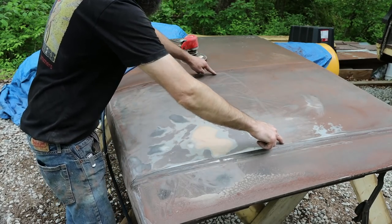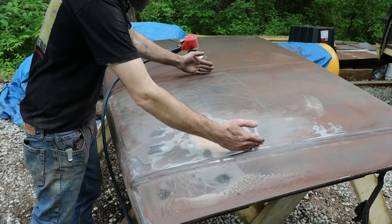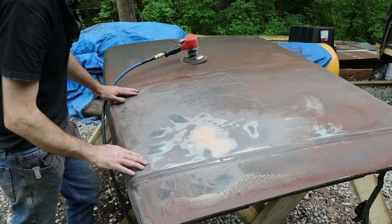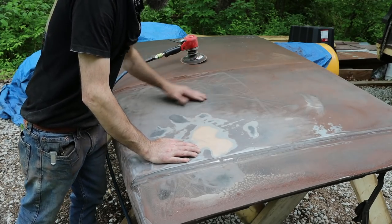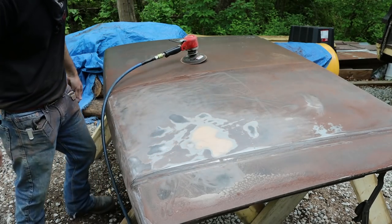Probably wipe an area about like that. Wipe it down. We've got two good body lines here to hide our filler. And then a big 2K primer, right? Heavy, high build, block it, boom. Done.